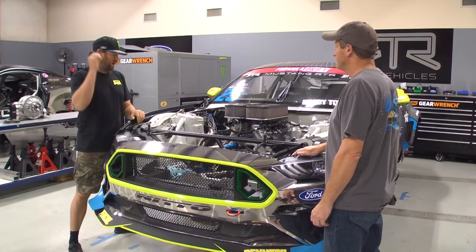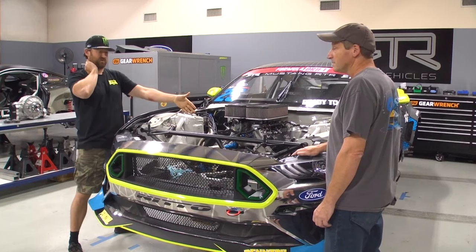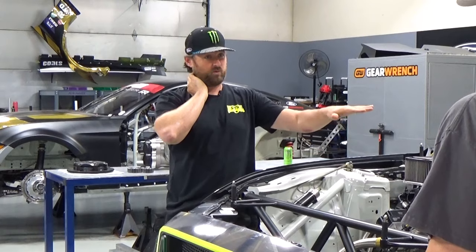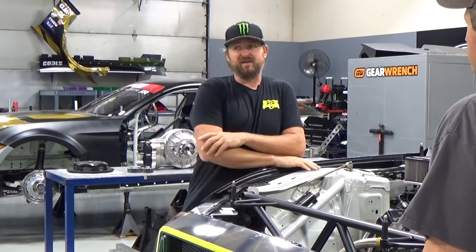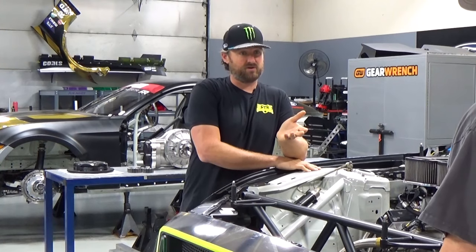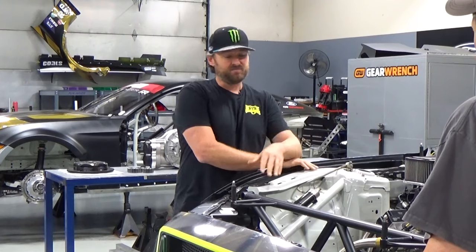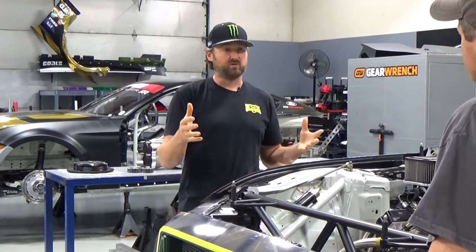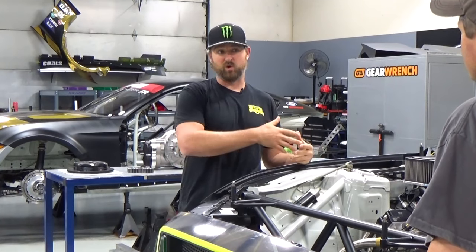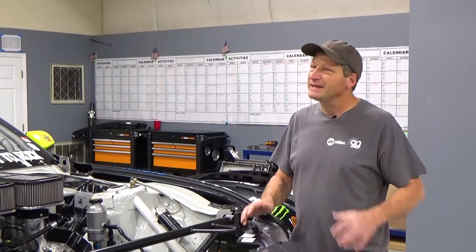Okay. So based on those learnings, this runs VP 116, so it's full race fuel. For us, we obviously wouldn't be able to have that high compression. So I think the 700 NA is great for your driver. And then when you need more juice, you got it. That's awesome. So for drifting and probably for road racing, you'll want to rely on that 700. I assume you're going to work with him to make sure it's very drivable, give you that nice torque band. It'll be an LS platform.